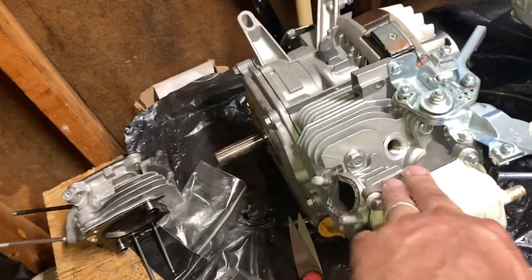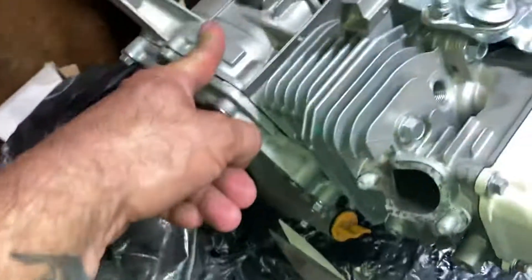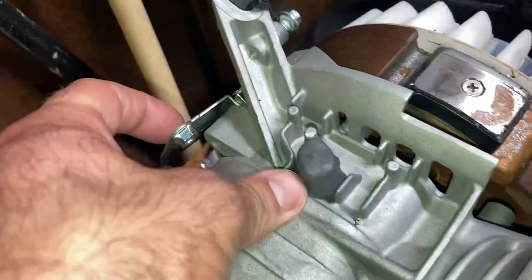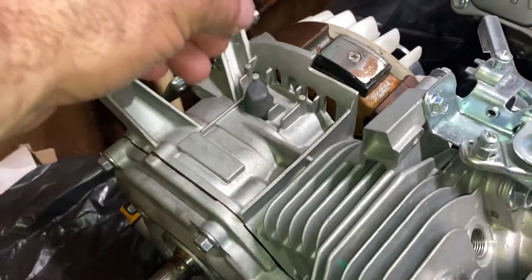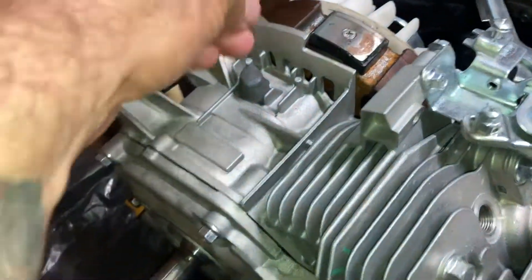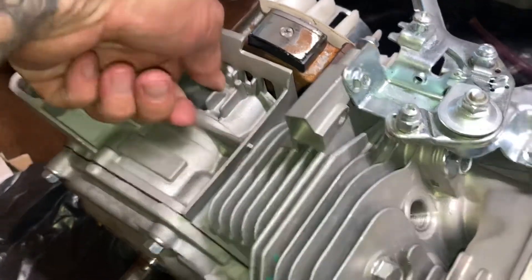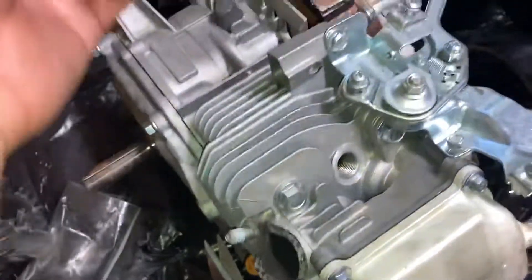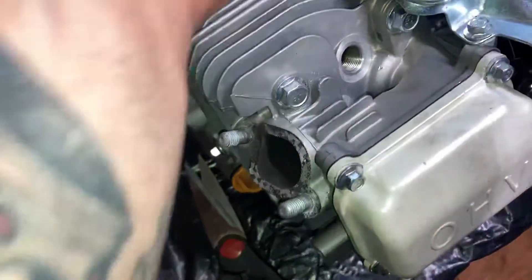What I did was delete the governor from the inside. Not only did I delete the governor inside, but I used this steel epoxy — whatever you want to call this stuff. I filled the inside real good: I slid a screw in with the epoxy around the screw, stuffed it, slid the screw in, poured some of this on top, molded it, and kept it flat and around the hole on the inside.